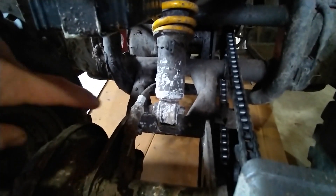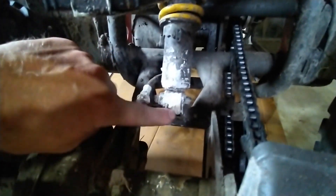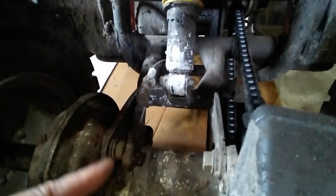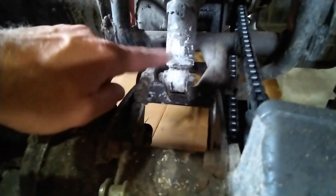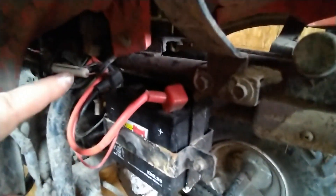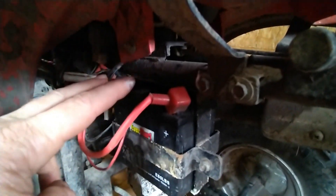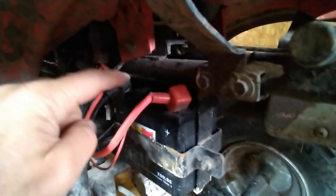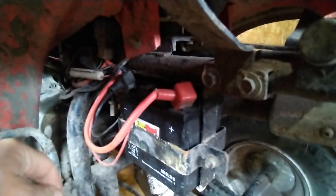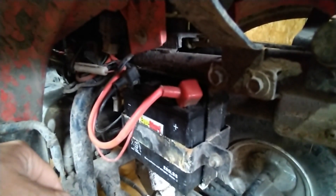Here you can see the corrosion around the shock area — it's actually quite a bit. This is battery acid coming down on all the linkage going to the brake and onto the swing arm. What's happening is the voltage regulator is over-volting the battery and it's causing the battery to bubble the sulfuric acid mixture right at the top. It probably ruined the battery already — we'll see after the fact if that's the case.